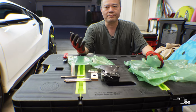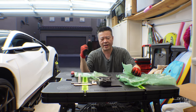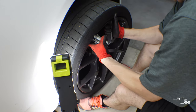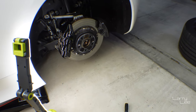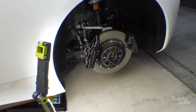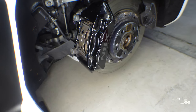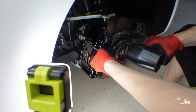I might as well tell you how much this was — these are $600 for the brake pads. With that said, let me show you how to take it off. I did pre-release them, un-torqued them — and traditionally the torque spec for these wheels is 125 pounds. You have to be careful not to scratch the calipers. I always like to have little buckets like these so I don't lose things. You can see the two pins and the clip.